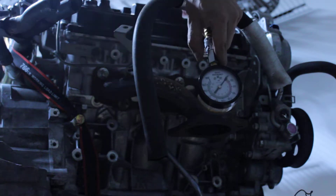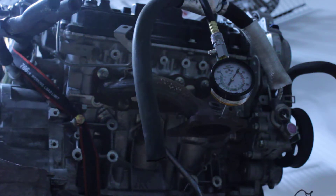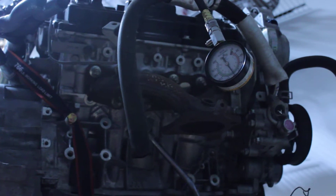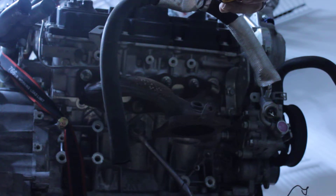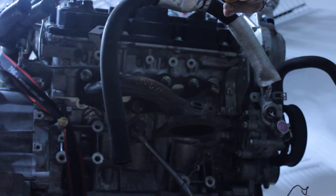If they're within 10 PSI of each other, that's totally fine. And this is a cold crank too, so if it's getting these numbers cold, then this is really good. I'm still thinking about getting the whole engine rebuilt, especially since I have it out, depending on these results. About 155 PSI. I don't release it right away — I look and see if it holds, which tells me about the valve conditions. 155.